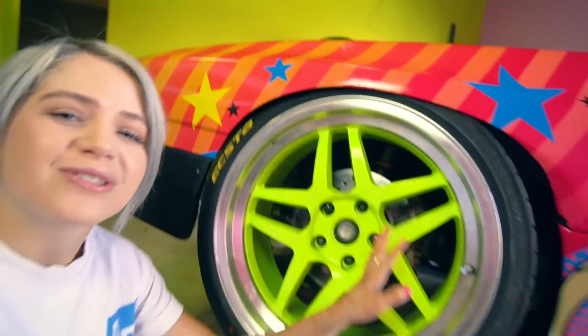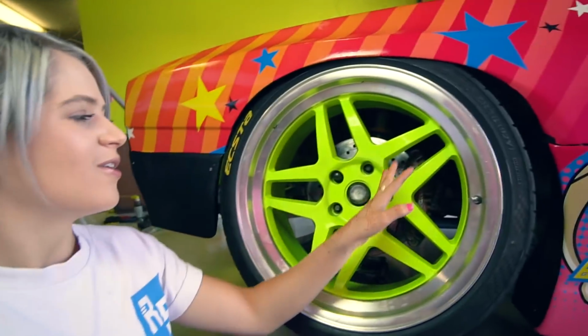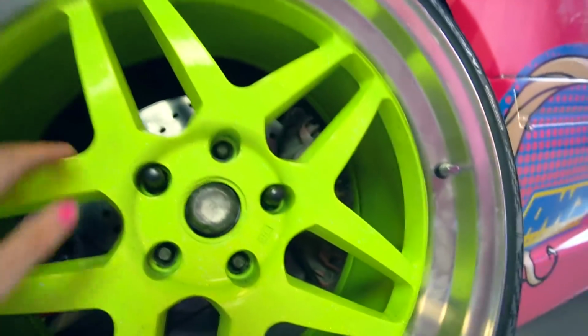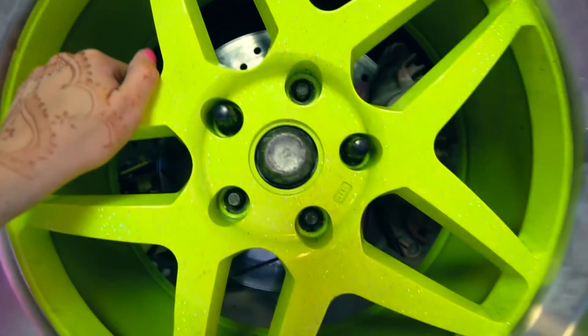That last clip is where it all went wrong. So we ran into some issues. It is the next day. Right when I got one side of the angle kit fully installed, I found a problem. My 326 Power rims are 18 by 10.5. The 10.5s in the front touch the coilovers, so this will not lay flat.